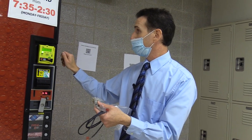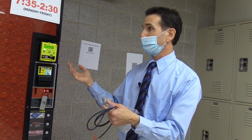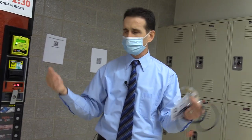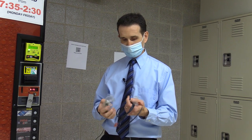I'm going to set it up so that when I activate the key switch, it puts the machine back into vend mode and turns on the lights. This is useful for days like in-service days when there are no students but lots of faculty in the building and I want the machine vending. I can simply come down, hit it with the key, and don't have to worry about opening the machine and reprogramming the control board.